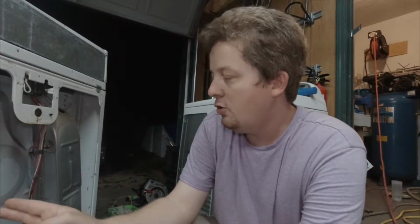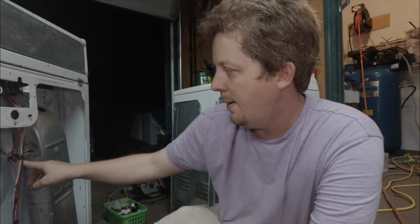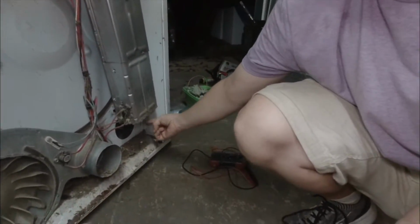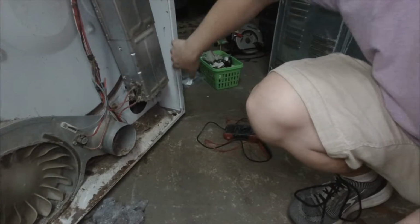And it's so crazy when you become a refurber how many times you will see, and I'm sure this is not actually repairmen doing this, this is probably homeowners that just don't know not to do this, they will take a fuse out of line and just wire it together and bypass a thermal fuse, thinking they've solved the problem when they are just on the edge of catching on fire. They have no idea how close they're coming to catching on fire. And how many dryers I've seen fires get started in, they always start, here's the heating element, and they always start right here. There'll be a big black spot and flames will be howling up the side, and this will all be black. But don't do that if you're a repair guy.